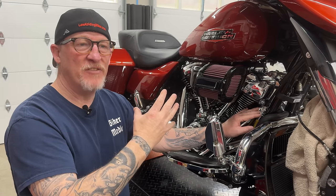These have flat spots where you can put a wrench on, but I find them pretty easy to adjust by hand — especially out in the field, you don't necessarily have to get a tool out. Just keep going back and checking your lever to see where it's at. Once you get it where you want it, this right here is your lock nut — you can lock it down on top so it doesn't move on you. Then, of course, bring your sleeve back over and your rubber boot just to keep dirt and grime out. This is probably the hardest part — getting that boot over.